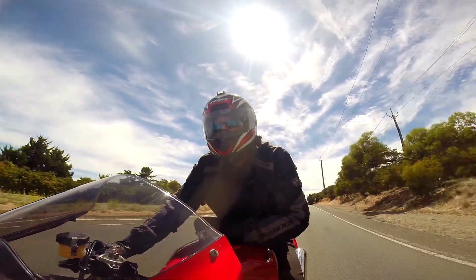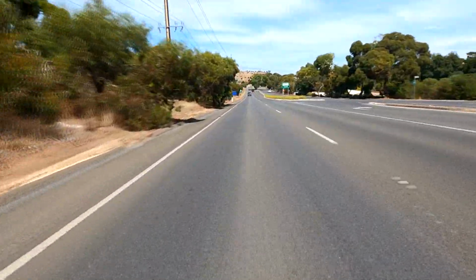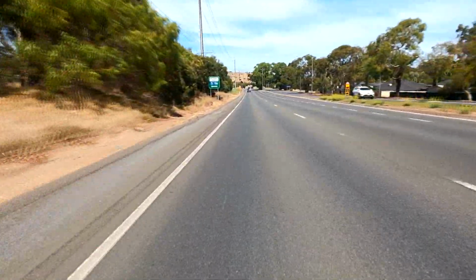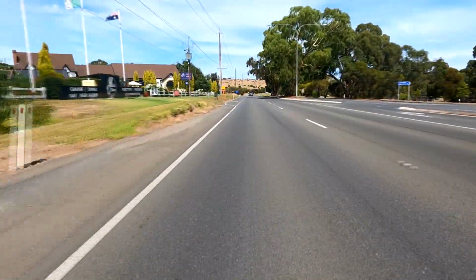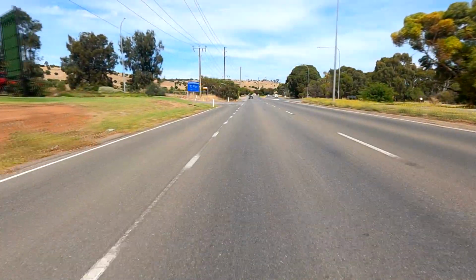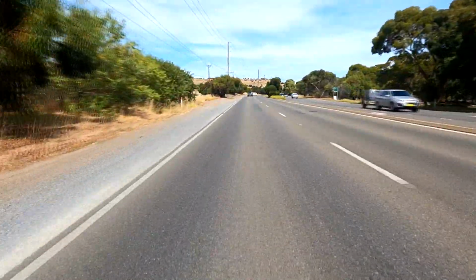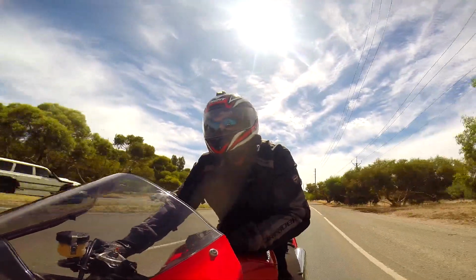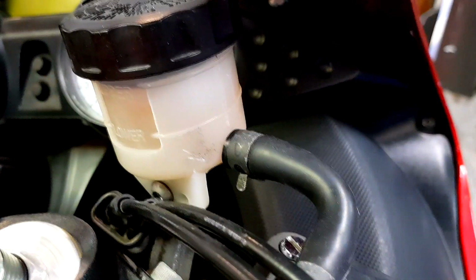So it's not too bad for 77,000 kilometers, a kit through the master cylinder is pretty good. Everything else was absolutely fine. One of the telltale giveaways that it was the master cylinder was that I had absolutely no leaks anywhere. So I thought to myself, well, it has to be the seals on the piston in the master cylinder. And sure enough, when I pulled out the piston and split the whole unit, I separated the piston and felt the seals were rock hard, absolutely rock hard.